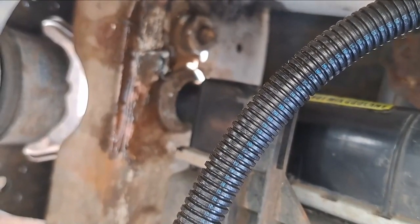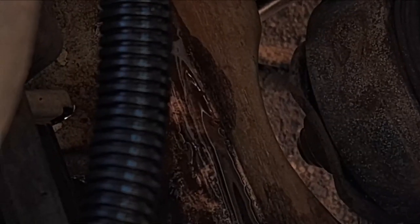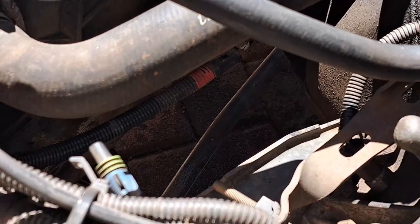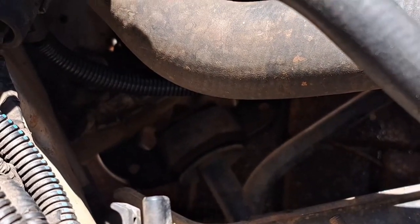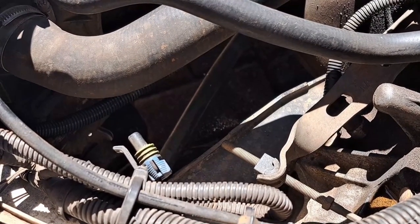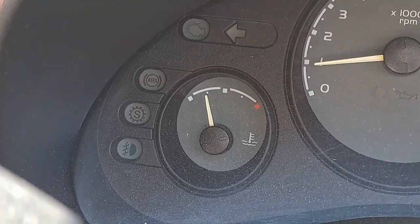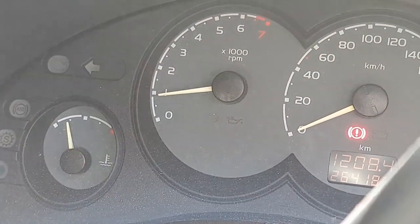The crimping didn't work — it started leaking again. So our next step, plan B, is to put in Rains Radiator stop-leak. We're idling the car with the heater on. Ten minutes in and it's still leaking. Fifteen minutes in, the leak seems worse and it started leaking in the second place as well, so now we've got two leaks. At this point I was really getting doubts about whether this stuff really works and was kind of wanting to give up. Then, believe it or not, 16 minutes in — both leaks stopped.